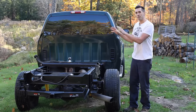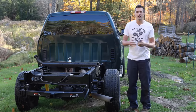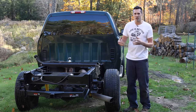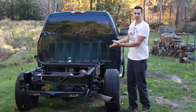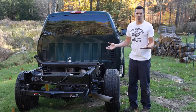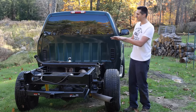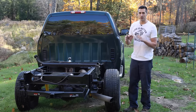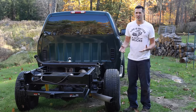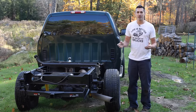You may have noticed that I've only been focusing on the back half of this frame, and that's because the front half is in totally fine shape — it's just got some surface rust but that's nothing major. All I did for the main frame rails on the back is just remove the loose rust, and that'll prevent water and salt and stuff from hanging out in all the little crevices. You saw that the crossmembers all needed to be replaced in the back — that was to be expected, but those are all in good shape now. While I was filming this video, I was also ordering parts for the aluminum flatbed. I just purchased some extruded aluminum decking for the flatbed, which is going to make it light and really strong. So keep your eyes open for that — it may be a while before the video comes out because I still have to procure a lot of parts and do some designing, but it is going to be a really exciting build. Thank you so much for watching and we will catch you in the next one.